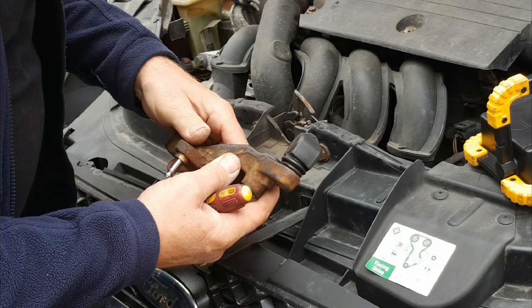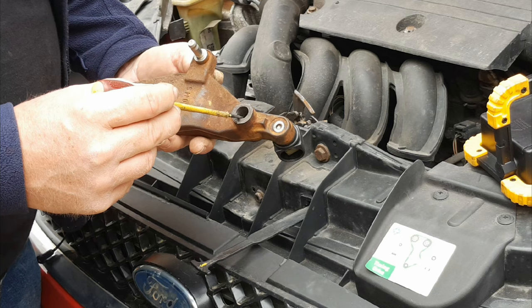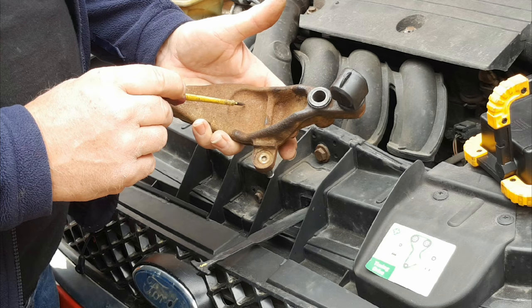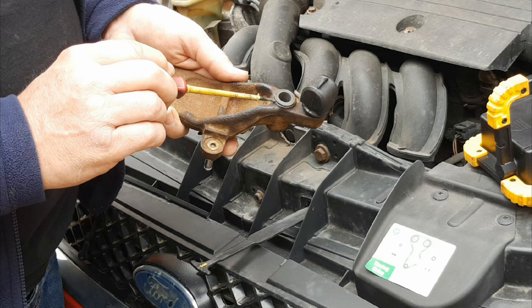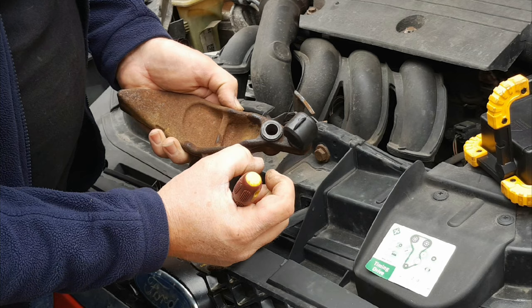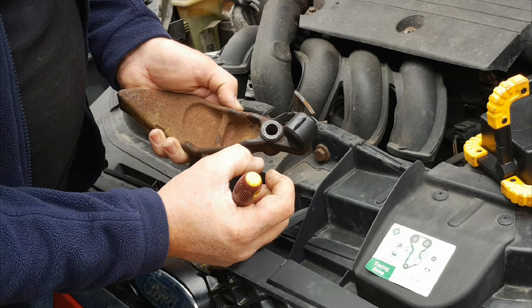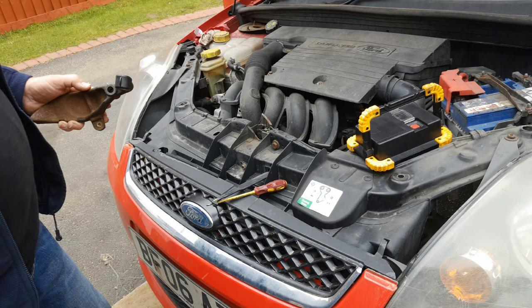The hole through this cast steel gear change lever is fitted with a bush — on earlier gearboxes it's a plastic bush and on later gearboxes it's a phosphor bronze bush. The root cause is that this casting is ordinary steel and is prone to rusting on the surface, because right there on the front of the gearbox it's in the worst possible environment. Water and dirt get in between the gear change arm and the bush from both ends, causing the inside of that hole to rust. That in turn squeezes the bush onto its pivot shaft, and as it rusts more and more it gets tighter and tighter, particularly when the gearbox gets hot because the pivot pin expands when it gets hot.